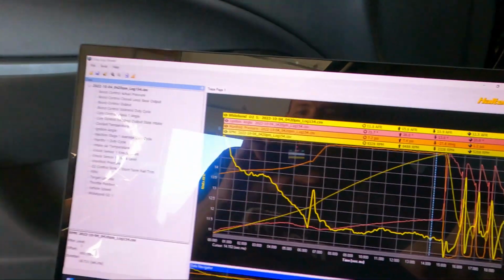That was 8,300 RPM. I forgot I got the limiter almost at 9. Probably should turn that back down from the track day. Put it back down to like 80, 82, 83. That's one way to break her in, I guess. So everything looks good, guys. Air fuel's money, everything's good. Letting it cool down right now, and then we'll bump her up a bit, see where she goes.